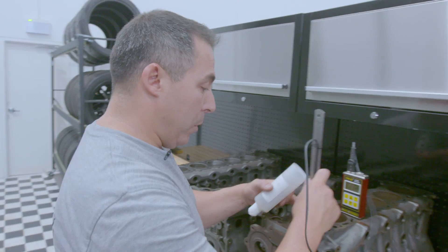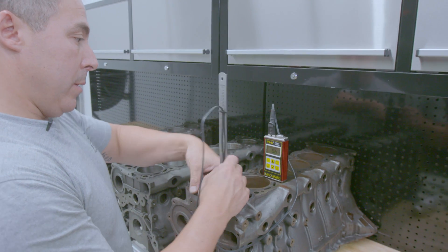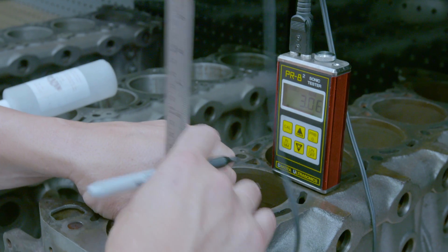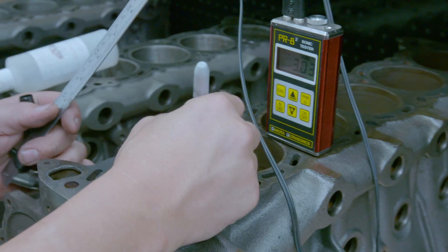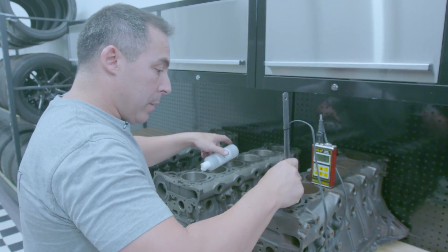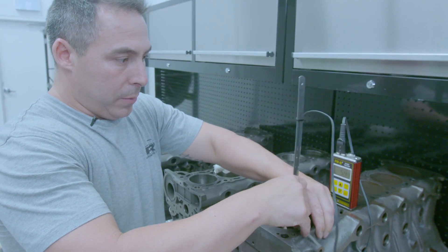We're going to do some quick bore testing here on the RB30. The thinnest part of that bore — I'm going to call it 4.6. Looks like we've got a thin bore here: 3.03. It's quite thin there — borderline. Then 5.3 on another spot. We're happy to run with 5, calling that 5.09. Ready to test the RB25.